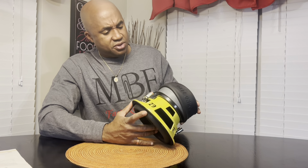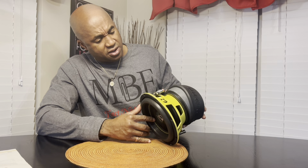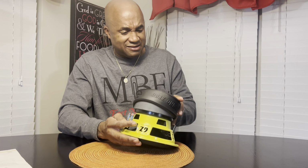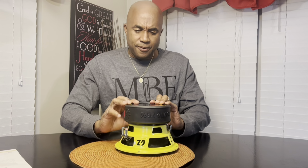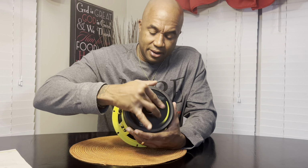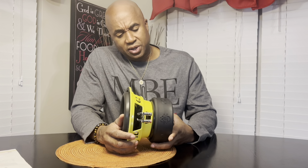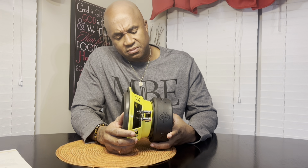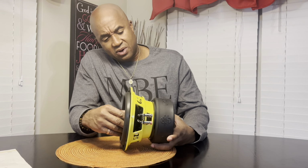Looks to be maybe 3/4 of an inch, a little more. Dual slug, and now I can see the top plate very well. It is definitely more than a 1/4 inch, a little bit more than a 1/4 inch, maybe 5/16 high. The venting amazes me that they only put one small pole vent in the back. They don't tell you what kind of former they utilize, but you can see that pretty copper coil and about average, some very thick wire there. The gauge thickness of the wires.